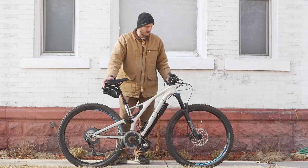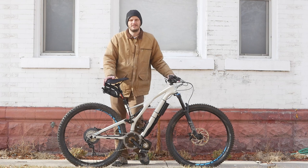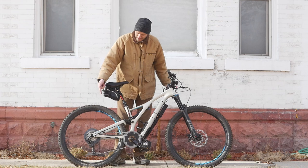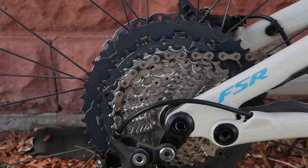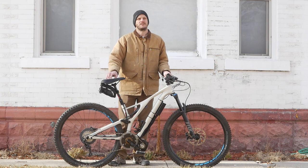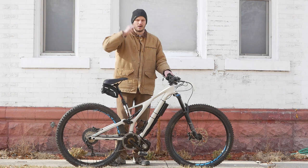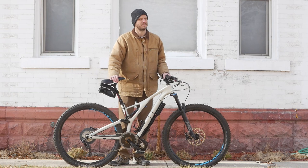So you can see the top speed was 34 miles per hour, but that's only at pulling 80% of the battery's potential. You could dial this up to 100% and probably get a couple, two, three more miles per hour — probably do close to 40. Also, this bike is awesome — it's got a 10-speed drivetrain, 10 speeds in the rear, so look at this monster low gear. It's just going to climb anything. Also in the Johnny Nerdout test, you could program this to have a soft start so it's not just a sudden jolt, and that's why I had it set for this one. So climbing is going to be a little smoother — you're not going to be doing wheelies all the time — and it's going to be a little bit easier on the drivetrain. You can change it though.